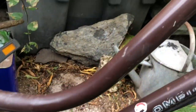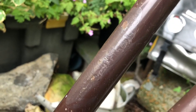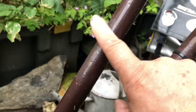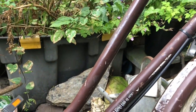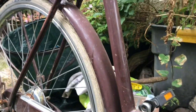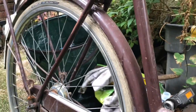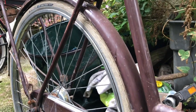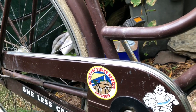There's been some bad touching up here — it had a big gash when I got it, so I just slapped some mismatched brown on. I'm going to sand that back and smooth it a bit. All of the paint I'm going to give a cut back with 1500 wet-and-dry, wet sanding, just to take all this top layer of environmental crud and degraded paint off and get back down to good paint.